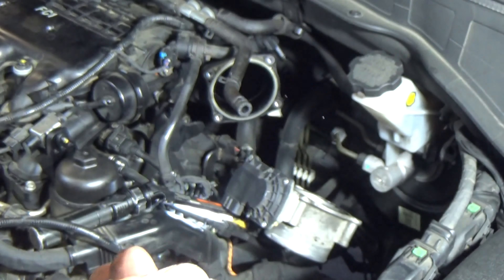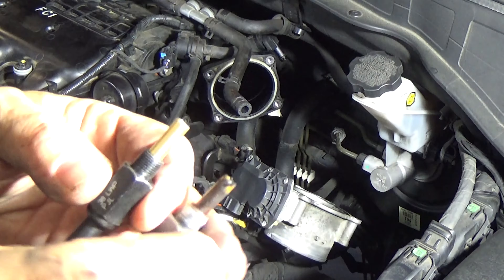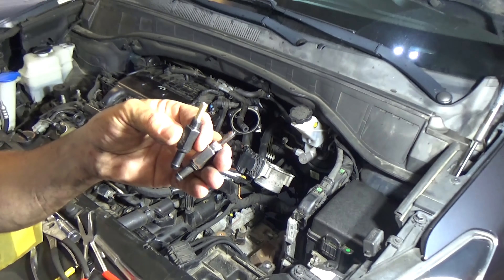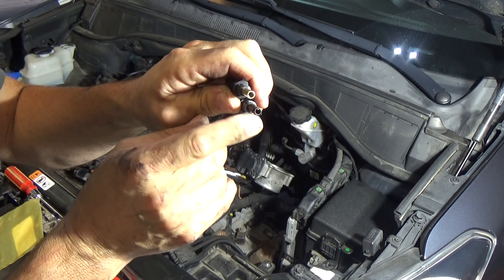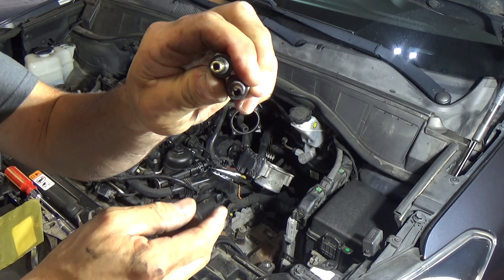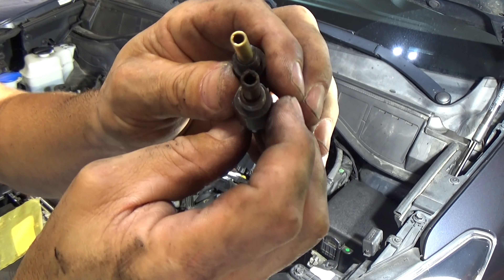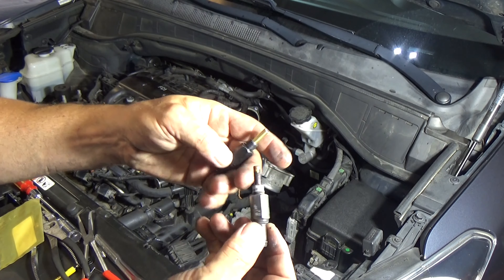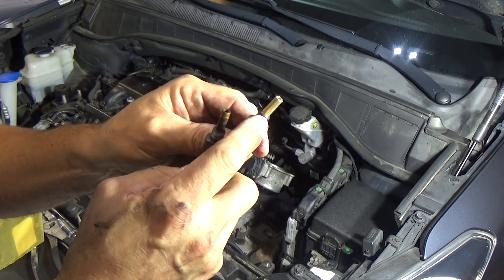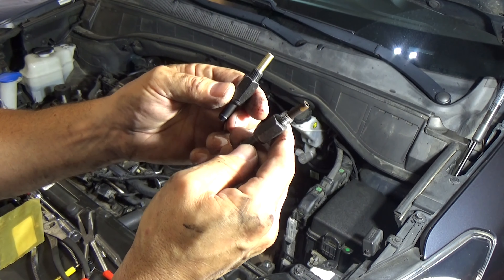It's still got the rattle — that's good. Here's our new one. So here's the old one — there's a little bit of grunge on the end. If this thing clogs, that wouldn't be good. This car has been serviced regularly with oil changes every 4,000 miles, so it's not too bad. What I'll do now is put a little bit of thread sealer on here — a little bit of pipe dope, so to speak — and we'll get this screwed back in.